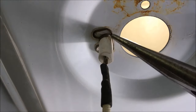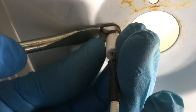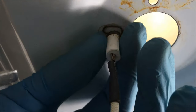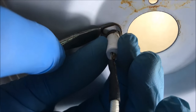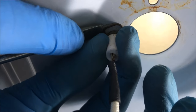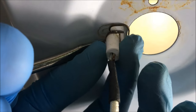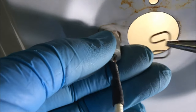We're going to remove the keeper now from this spark igniter. We're going to push it back with a screwdriver, just to protect this. I'm going to protect mine because it actually works. If yours isn't working, it doesn't really matter. So use this screwdriver to work it off — that keeper. See it coming off right there? Just ease it off. Once it gets to a certain point, you can use the needle nose pliers to get the rest of it. There you go — there's the keeper.